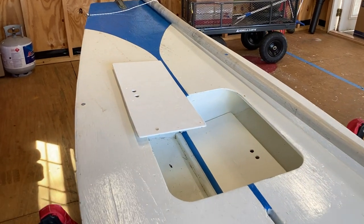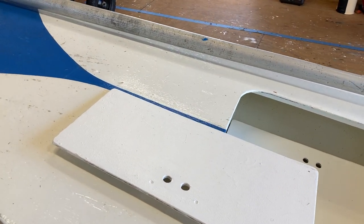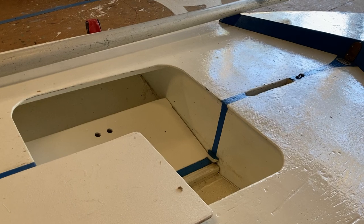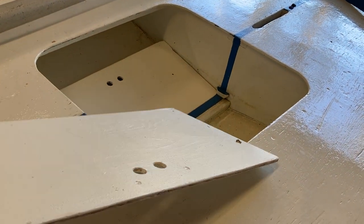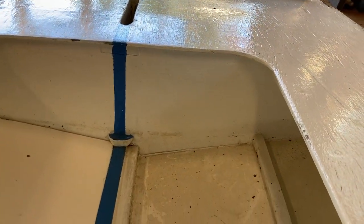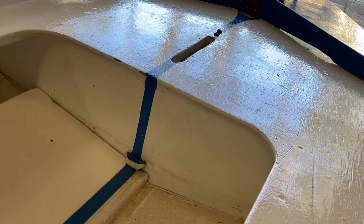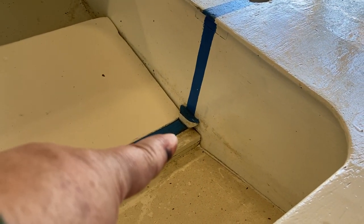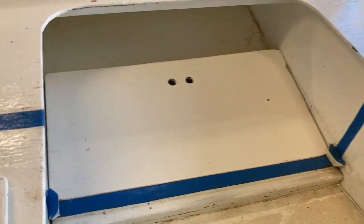One of the things we wanted to talk about on Chip today are the floorboards — they come with the boat. This 1963 model has a cockpit that's actually a little bit bigger than the 1953 model we had. The floorboards are these little quarter-inch pieces of marine grade plywood with a couple of finger holes and a little cleat on the bottom. The cleat notches inside the stringer on the keel to keep it from moving left to right, and the cockpit bulkheads keep it from moving fore and aft. There are also little tabs on the forward and aft bulkhead that the floorboard locks under.